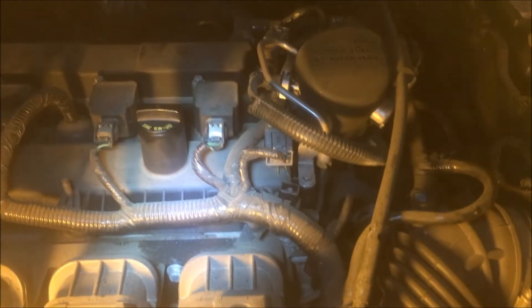There we go. Three pieces are done — the oil filter is back in, the oil plug is back in, and we've got four quarts of fresh oil in the engine. Go ahead and start the engine and let it run for about one to two minutes before we drive it.